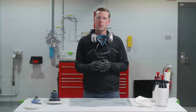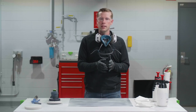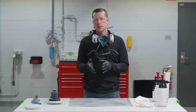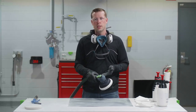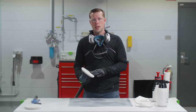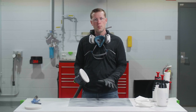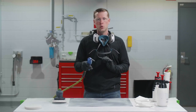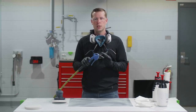Number two, sanded original paint. This is the actual OEM paint that we're sanding — a good example would be an adjacent panel that we're prepping for a blend. A big recommendation is to use dust extraction during the sanding process. After completing sanding, we can use the 3M Scotch-Brite clean and finish disc with a Festool machine, which allows dust to travel right through the pad so the vacuum captures additional surface dust. We then use an air blower with clean dry air over the entire surface — at that point there should be very minimal dust remaining.